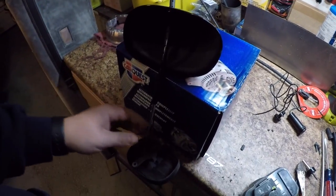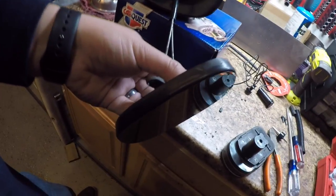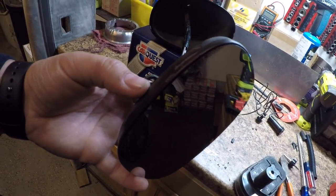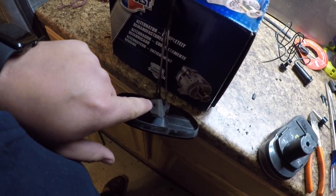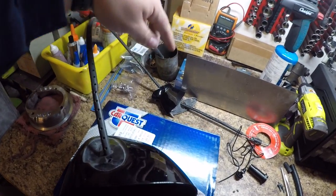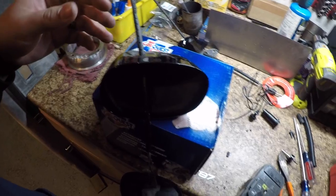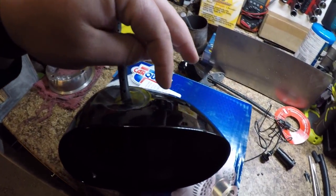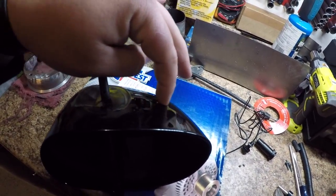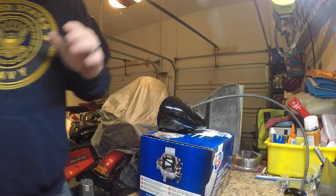So that brings me to the rearview mirror, which does have to be removed. To remove the glass you have to insert a screwdriver through the top — it's a Phillips head — and then there's one more screw holding it on the bottom, which is inside the base of the mirror. The dish does have to come off the door for you to be able to do this. I've already checked that the mirror itself doesn't go too far in — it barely goes like half an inch — so I'm going to drill the hole right here, make sure it clears the stand, and install the projector. This is the position I'm going to work on, and here we go.